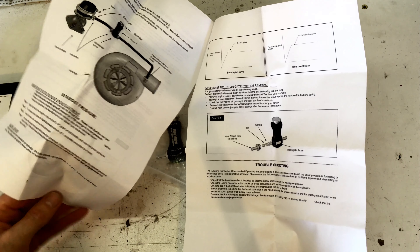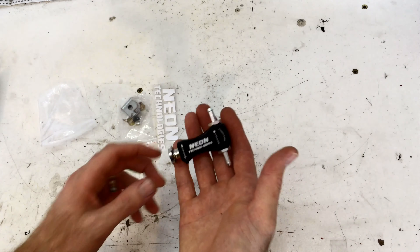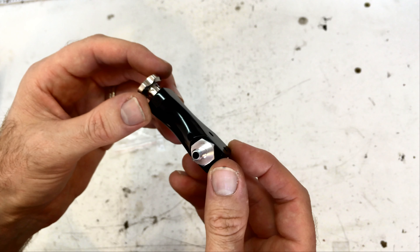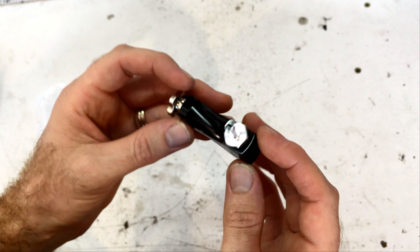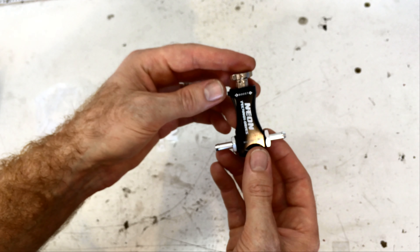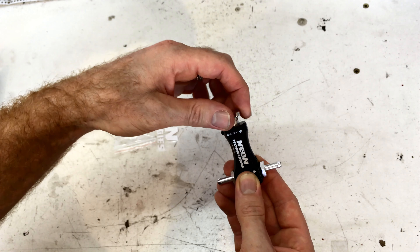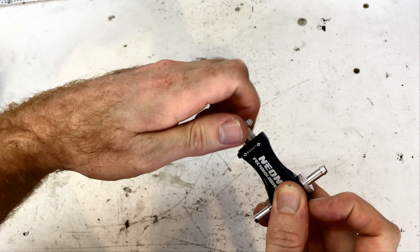Let's check it out. Nice heavy feeling unit. Seems to pretty closely resemble the Turbosmart units. It is a directional valve as it's a gated valve, and what that means is it's got a ball and a seat, so that it doesn't actually flow air through it until the predetermined pressure - theoretically bringing boost on quicker. The knob on top has a notch and ball type catch to stop it from rattling loose, and seems to work quite smoothly.